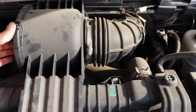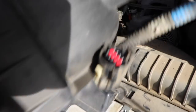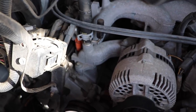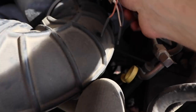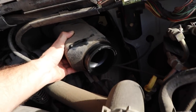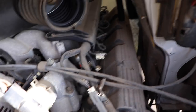Once the filter housing is removed, I also remove the plug that connects to it in the back. Once you've done that you can access two of the front plugs a little bit better. To get even better access, I'm also removing this hose here — there's a screw right there to loosen it. I just removed that screw and was able to take it off. It's just a smaller portion with a set screw on it. Now you can see a lot better.